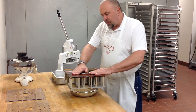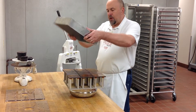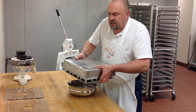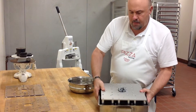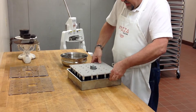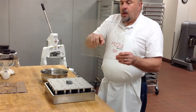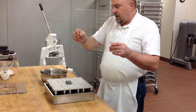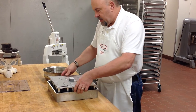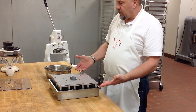Now I've got them all done — they're all pretty much flush with the knives. I'm going to take the pan, put it on upside down over the assembly, grasp it, and flip it over. That keeps everything together. I push down to make sure this is nice and tight. There is an oblong hole in the center that should be lined up from front to back. Then I put the lock plate down over it, and it just slides over and locks in place.